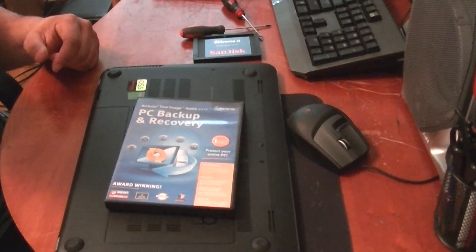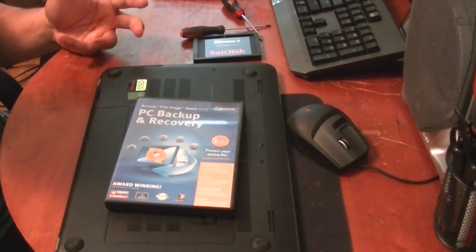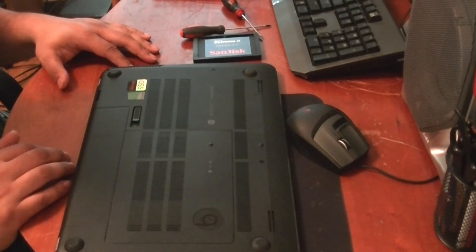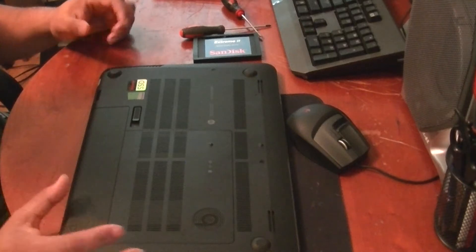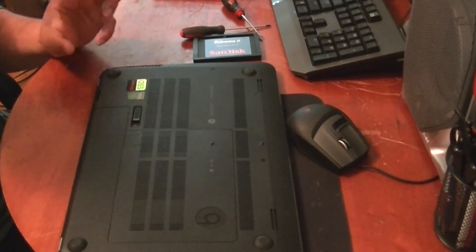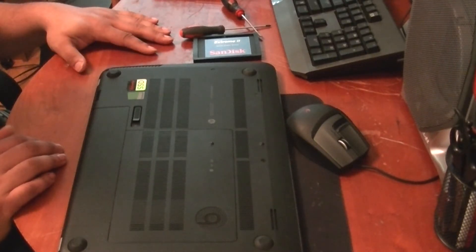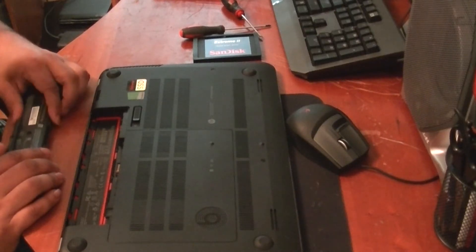You have two options: get Acronis for about $20 from Newegg or similar — get the newer version — clone your drive and it should work just fine. Or you can buy another copy of Windows 8. I actually installed Windows 8.1 consumer preview on this machine just to verify it wasn't a drive issue, and it installed fine. Buying another copy of Windows 8 was not an option for me since it came with the machine — I'm not paying for it twice. So I cloned it, it worked really well.